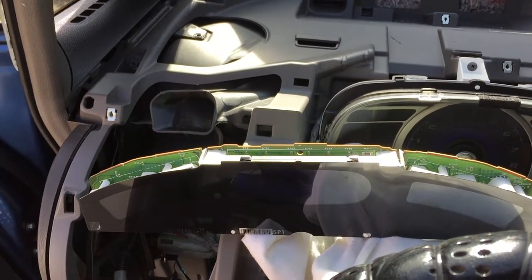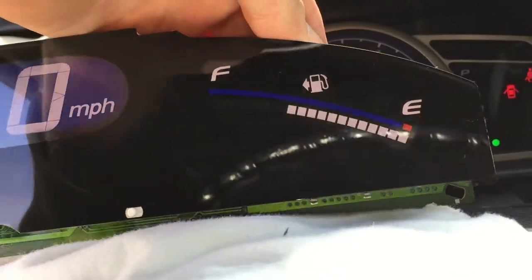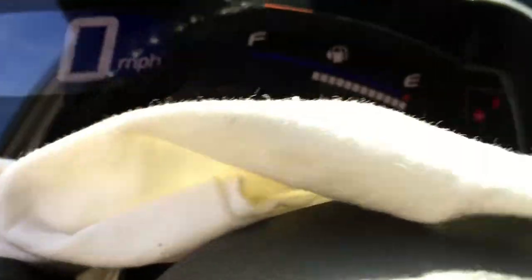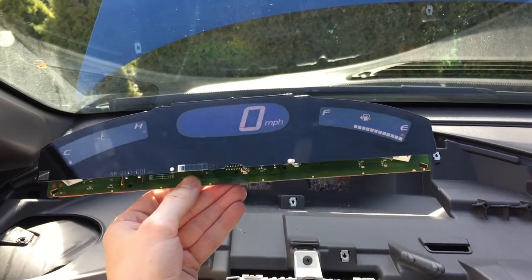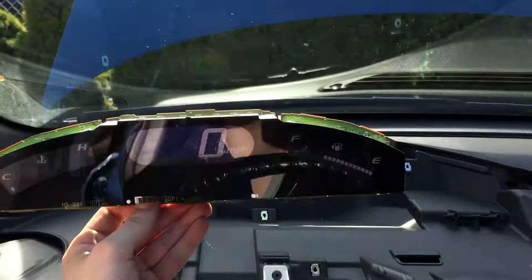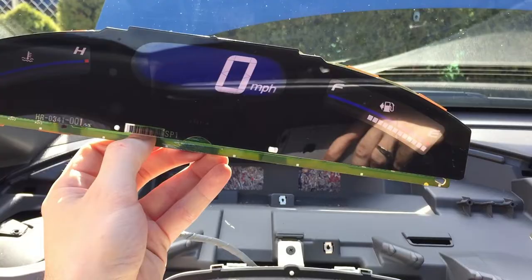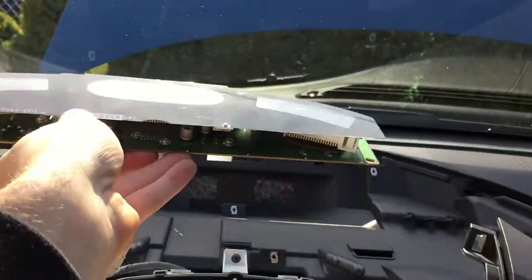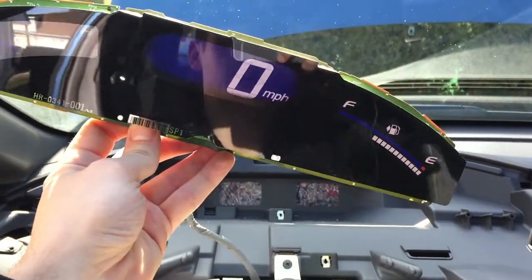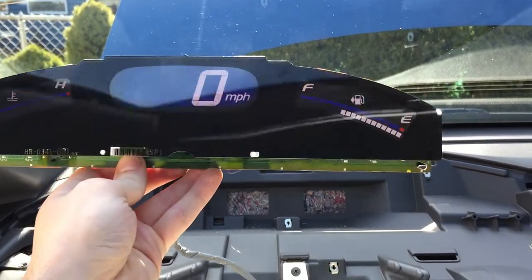I got the cluster hooked back up, put the battery back on, and I just want to turn it on to see what's going on. Let's see if we can see the fuel gauge — it's working good, within parameters. Temperature — everything looks to be well. I tried moving around some of the parts and it did not invert on me, so it's really a funky, tricky situation. Since I don't see anything wrong, if it's still inverting you can either just leave it, drive it, or buy a new upper gauge cluster to fix the issue.